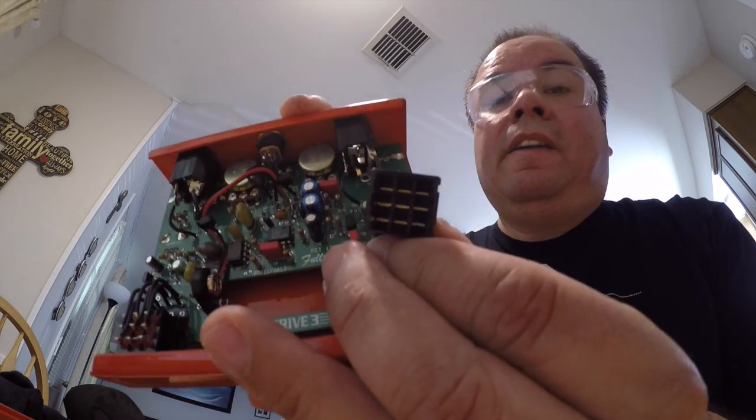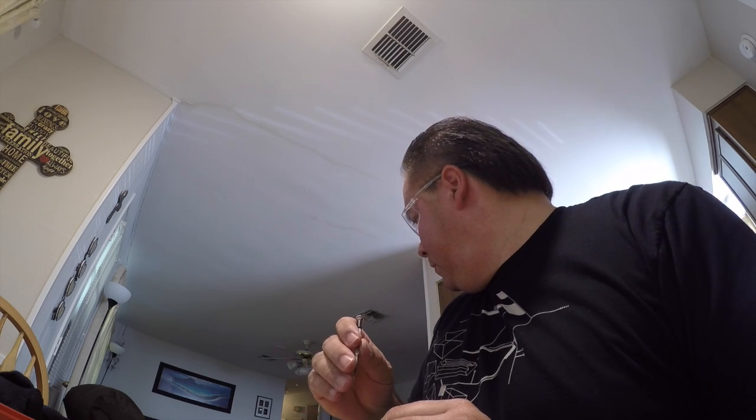All of them are clean now — just going to drop them back in the compartment. The contacts look pretty clean in there, but I always like to scrape them just in case there's some carbon I can't see. I don't think it's a good idea to put the sandpaper down there because you might get particles in there. There's a lot of lube in here, so just use a sharp edge — a screwdriver or something — and scrape off that layer of carbon.